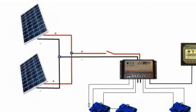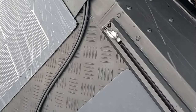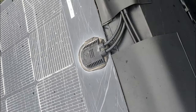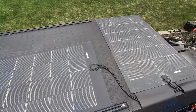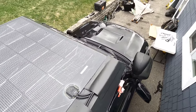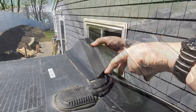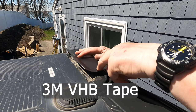Long story short, what I've done is split the positive coming from the batteries and split the negative, and sent one to each one of the panels — just like the diagram shows. I routed the new wiring right down to the existing wiring, spliced in, creating a Y or a T. Then after I was done I took some Kydex sheets — 12x12s from Amazon — using some 3M heavy-duty tape and a heat gun, and made some shielding. Here's how I did that.